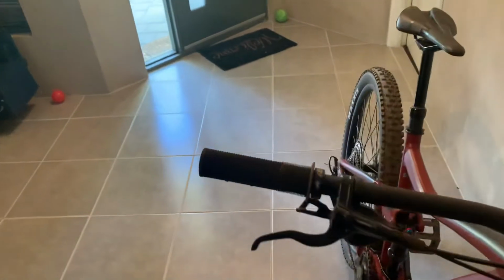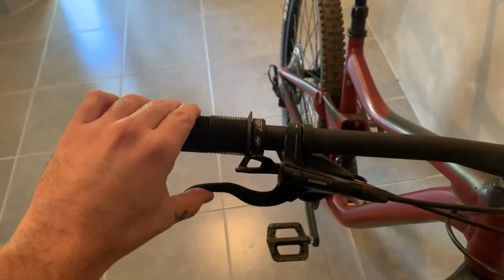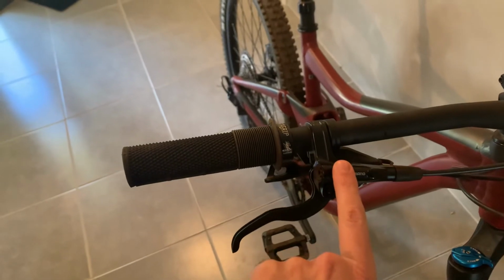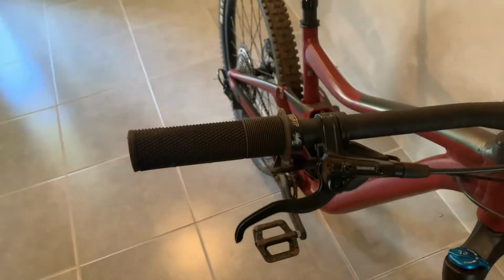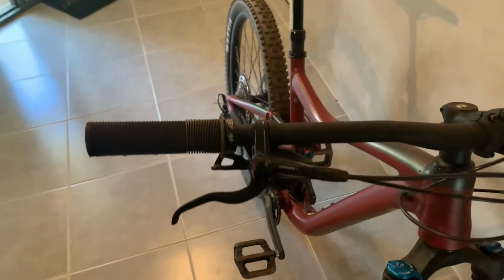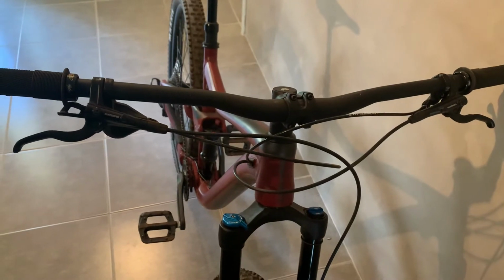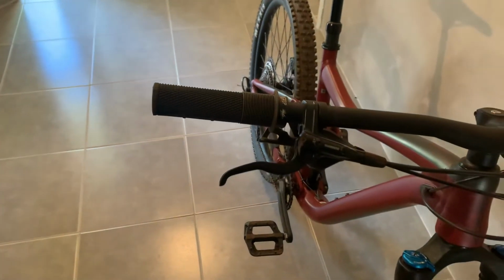The bike itself is really comfortable to ride. A few little changes I've put in. Didn't purposely do this, but the Deore brakes I got when I purchased the bike came with the one finger short levers here. A little bit different model here, and they're attached separately here instead of sliding them off the bar. First ride in, they actually started leaking oil from in here and dripping oil in there. I did a brake bleed and it didn't fix it, so I took it back to where I bought it from. They replaced them straight out. Shimano were really good about it. I would have preferred that they kept the same levers on, but I just adjusted these a little bit more.